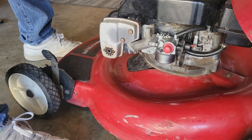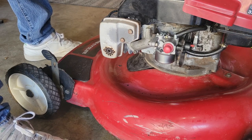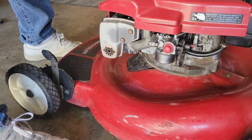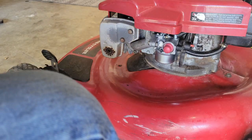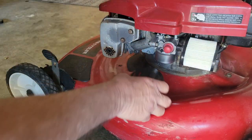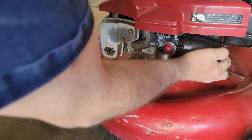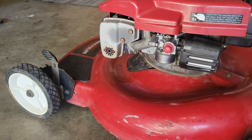In this case, he didn't take a picture and it ended up in my yard instead of theirs, which is good for me I suppose. But this motor was ready for the junkyard only because he put a carburetor on it and did not attach the springs correctly. And there you have it — we didn't even prime it to start it. It sounds real solid.